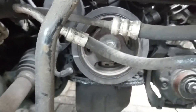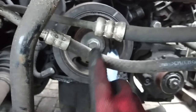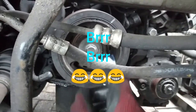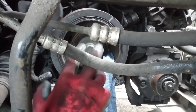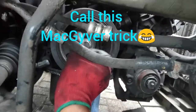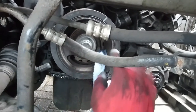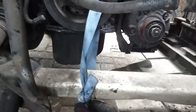For the pulley, if you have an impact wrench it's much easier because it just goes and comes out. Because I don't have one, as I was trying to turn this the pulley was turning the engine as well, so I tied it with this to here and now it's coming out. If you have the same problem, just put something to tie it - maybe here or here - so it doesn't move, then you can remove it.